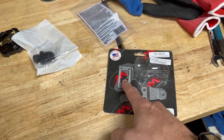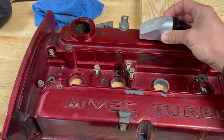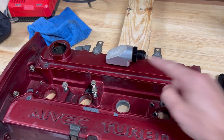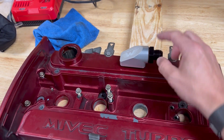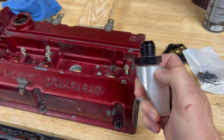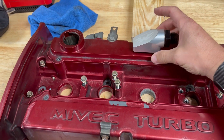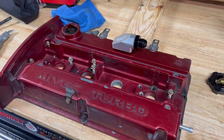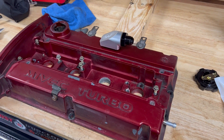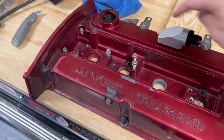It comes with a little bracket that also acts as a template. It's kind of big — overkill really, since it's meant for a big V8. You can run a dash 12 — it's a dash 12 ORB to dash 10 AN. The plan is to mount that there on one of the flat spots, and I'm also going to eliminate the PCV and block that off.